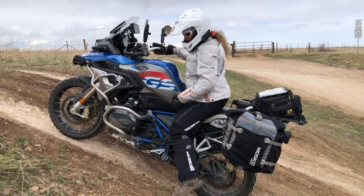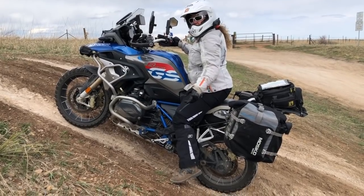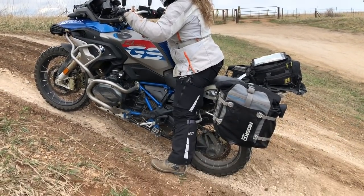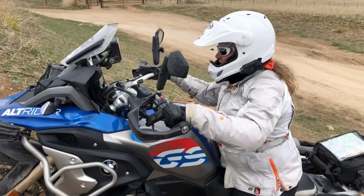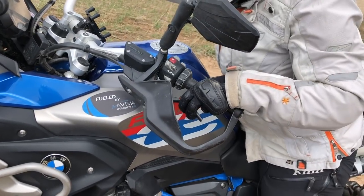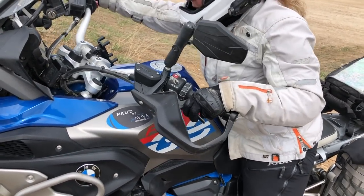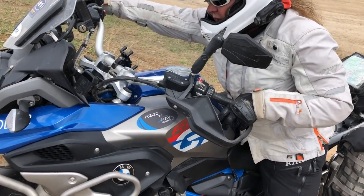Keep in mind that on a steep enough hill, your engine will sometimes cycle through a compression. It's no big deal, just know that it may do it. With your left foot firmly planted and right foot loosely on the rear brake, begin turning the bike around by briefly, yet not fully, pulling the clutch lever in. We call this clutching. This allows the bike to roll when we want it to, but re-engages the rear wheel into first gear when the clutch is out, acting like a rear brake.